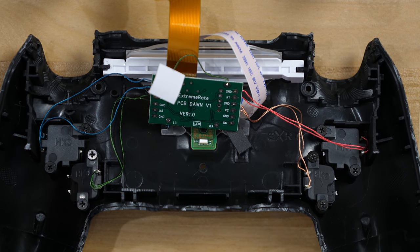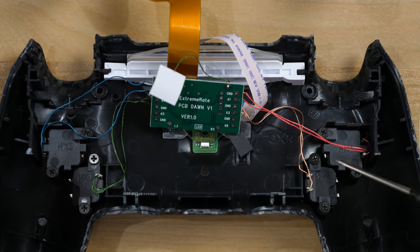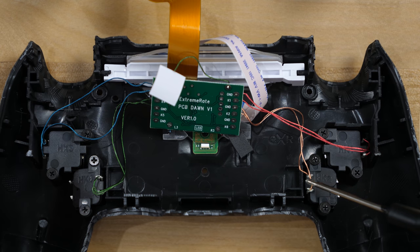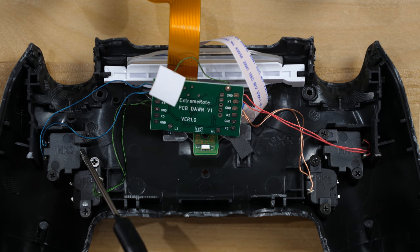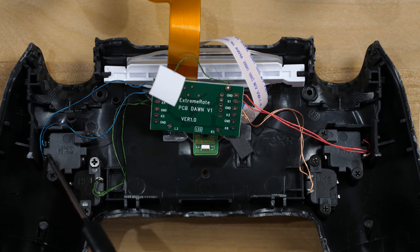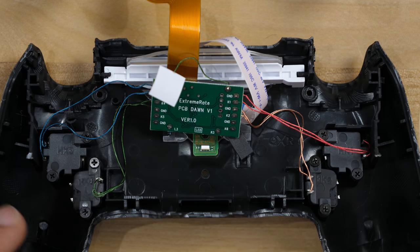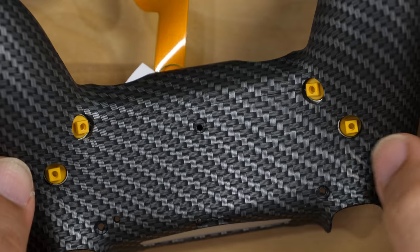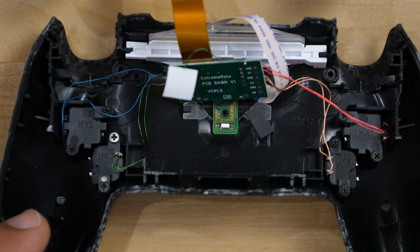The main thing to pay attention to is the orientation of the wires. The red wire is actually on the outside on this button here, and the gold or orange colored ones are on the inside. Same thing goes for green and for blue — they have to be flipped this way. The blue wire should not come on this side, it should be on that side. It's not going to make any electrical difference, but it's going to make a difference in how it sits. When you flip it upside down, all the buttons should be there and you should be able to press them with your thumb.